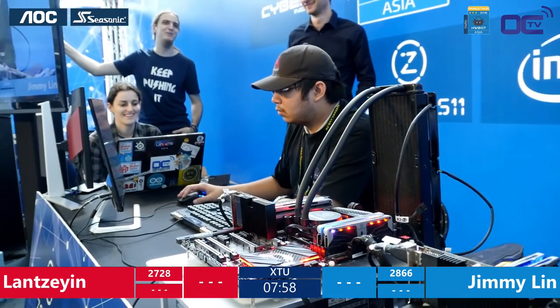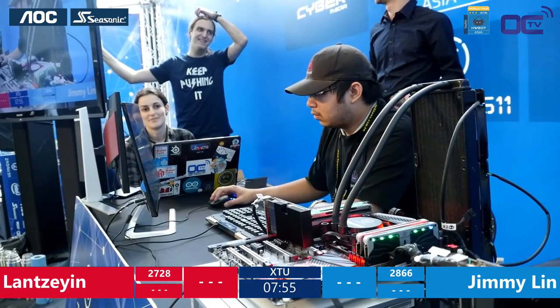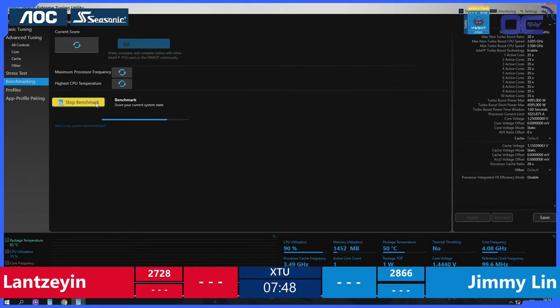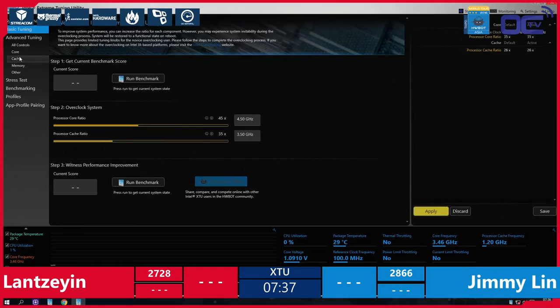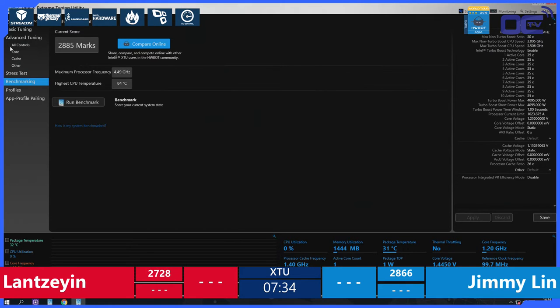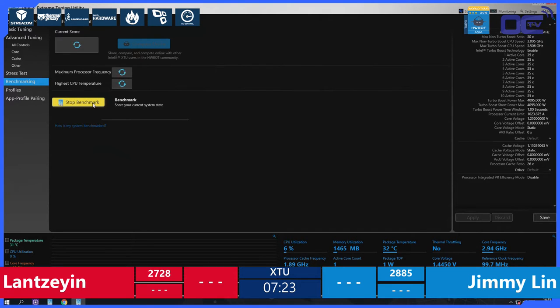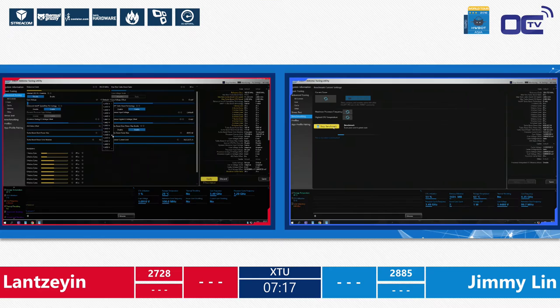There are still a lot of values they can change, and the level we're seeing from these amateurs is constantly increasing. Last year we only worked with the G3258 Pentium Anniversary Edition from Intel — only a two-core CPU — and we saw voltages over 1.6–1.7V on air, where Intel advises staying below 1.4V core for safety. Now at 2885 — coming closer to Jimmy's best score of 2891. It's only six points shy, so he's getting there again, and Lan is still trying to dial in the same frequency.